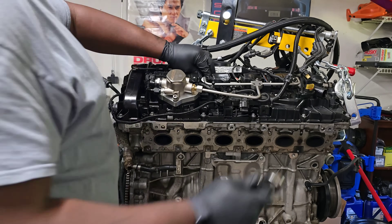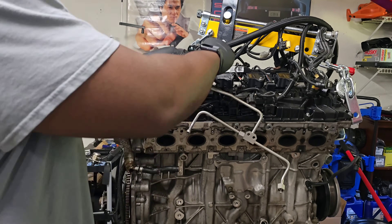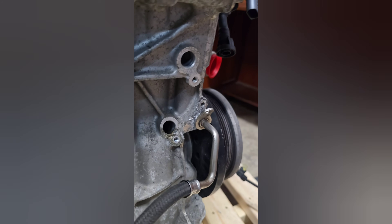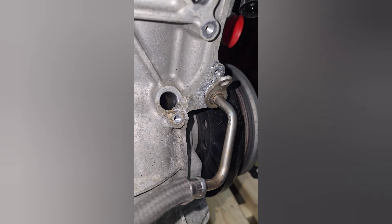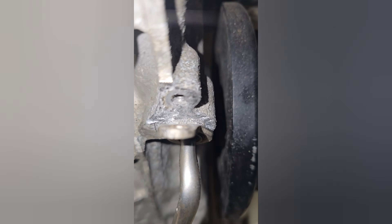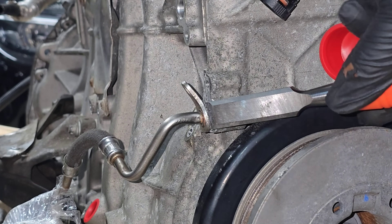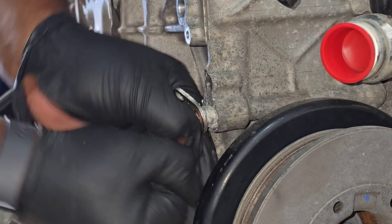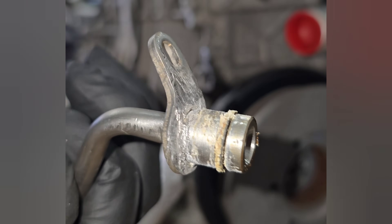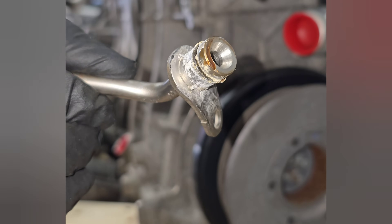Then we pulled all of our fueling off. I have the Precision Raceworks gauntlet high pressure fuel pump and Nostrom stage two injectors, so we pulled all of that per the company's instructions to prepare them for the new engine. One of the most annoying things with a used engine is finding out that some of the stuff that wasn't removed is just because it was difficult and the people selling it didn't care to put that much energy into it. In my case it was the turbo feed line — no matter what I did, it would not come off without a fight. I used a chisel that only kind of bent the flange and it just wouldn't budge. Eventually I did get it off, but this definitely hasn't been removed since the engine was assembled — it just looks like the previous owner drove through a couple of saltwater lakes, but thankfully we got it all out.